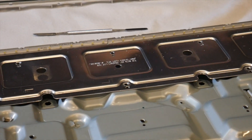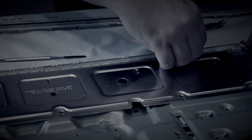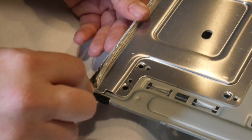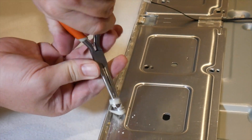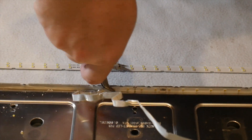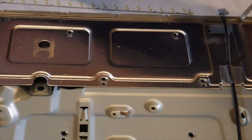Do you see it spark? I saw the whole thing light up. Be careful — use a multimeter, or ensure that the power board is fully disconnected from the LED connectors before working with these LED strips. High voltage is no joke. After disconnecting the connectors, carefully work your way across the strip, removing it from the frame of the TV. These strips will not be reused, so don't be afraid to bend and wrap them to get them fully removed. Ensure that any remaining adhesive is completely removed so that the new strips will be able to be installed correctly.